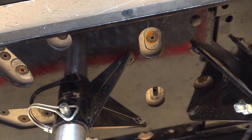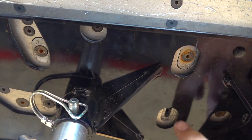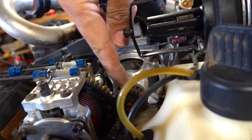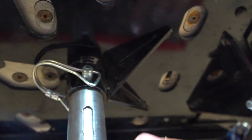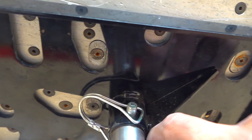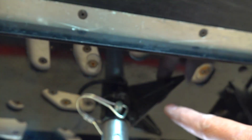As I glance down underneath the plate that I have, I can see I'm missing an insert right here. This insert actually has a number on it — you'll see it says 20 right there. That's the number of teeth on the pinion of the engine, right here. So the reason why is it's an offset for the gear mesh. Missing one isn't like a big deal, but that is a motor mount, so I wanna make sure to fix that and replace that right away. If you have a different pinion size, it'll say a different number — 18 or 19 or whatever you have in there.